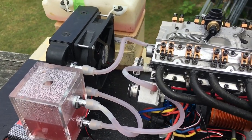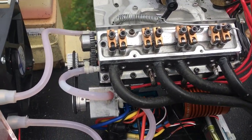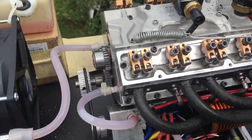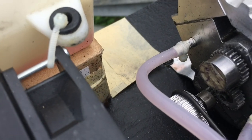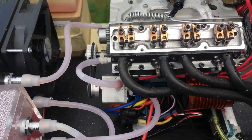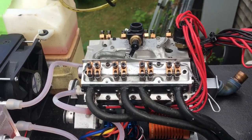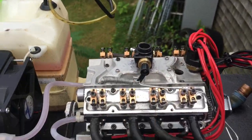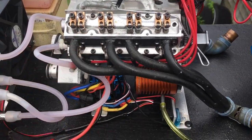The important thing: I tried for weeks and weeks trying to figure out why it wouldn't start — it would just pop and fart. I played with the timing, I've got the timing cover off. I even set my timing by the cam using the firing order 1-8-4-3-6-5-7-2. I took the supercharger off and put one carb on it because I contacted Gary and he was super helpful.